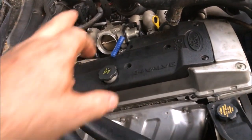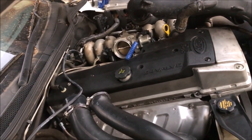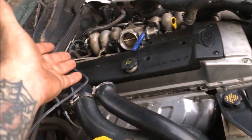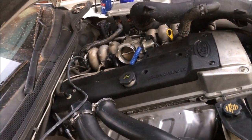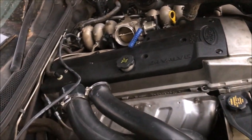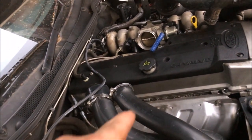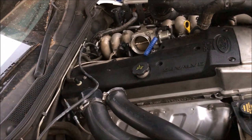So what I'm doing now is putting the NA map sensor back in so I can at least drive it. Tomorrow I've got to take it to my mate's workshop to service the transmission and sort stuff out underneath. Then on Wednesday I've got to drive about 30km to the tuner. Without the correct map sensor I can't drive it anywhere, so I'm going to swap the map sensor when I arrive at the tuner. Since searching online — nothing specifically on this conversion, but looking at upgraded map sensors for turbos — everyone says it just won't work until you put the tune in it.